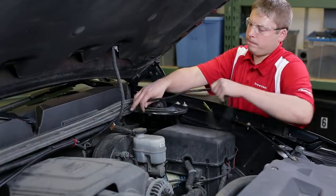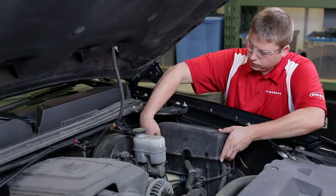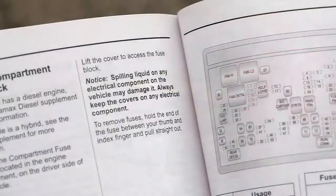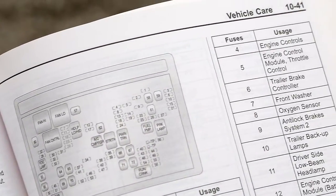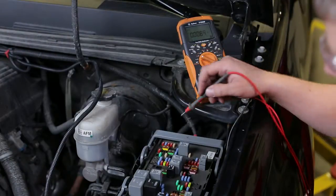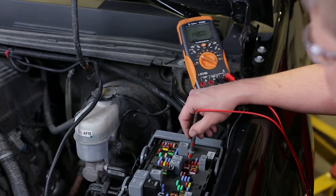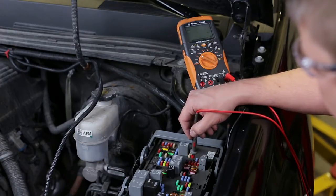Start the harness's electrical connection to the vehicle with the included fuse tap. Refer to the ignition fuse tap instructions in the installation guide for complete details. Check your vehicle's owner's manual to determine a safe and suitable ignition fuse port to use. Use a multimeter to verify that the port's voltage is between 11.8 volts and 15 volts DC when the ignition is on, and 0 volts when it is off.